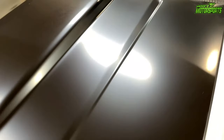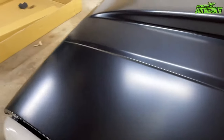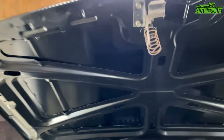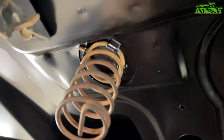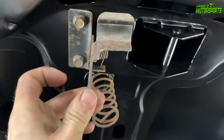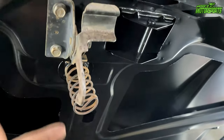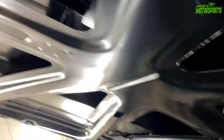I'm going to show you it pops perfectly fine. When I first got this truck it didn't pop whenever you did that — you'd have to bang on the hood — but definitely really nice. This is pretty simple. You can pry these little pieces up and then the spring twists out and then pulls out. When you get this, you will have to hammer them back down for that spring to go back in. They did sell brand new hardware but I just didn't have the funds; I can sand it down, sandblast it and repaint it and it'll look good as new. These get kind of noisy so I sprayed them with some Bestline no-squeak spray and they're not as noisy as they used to be — definitely really nice construction.